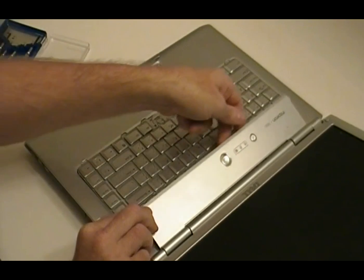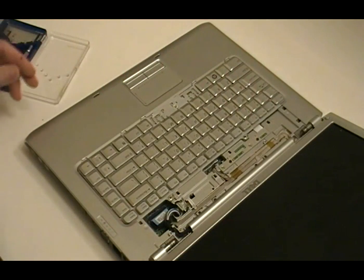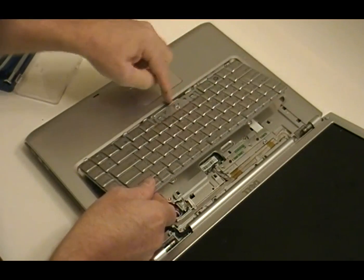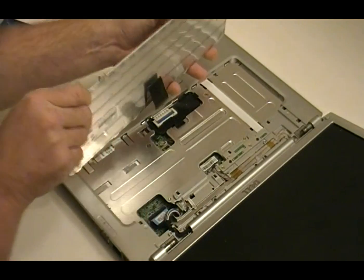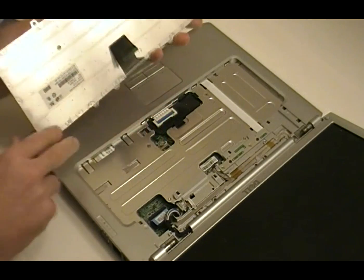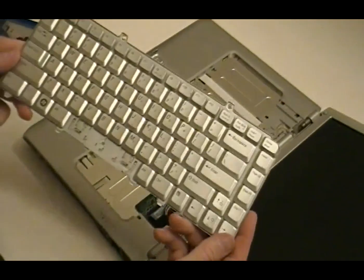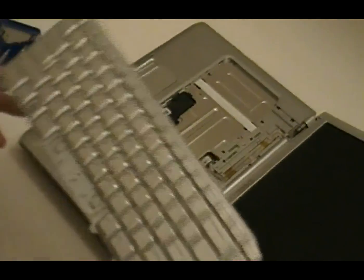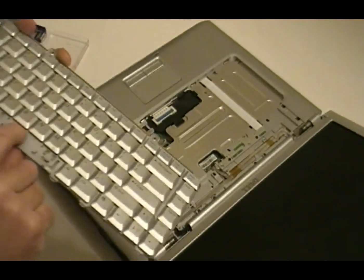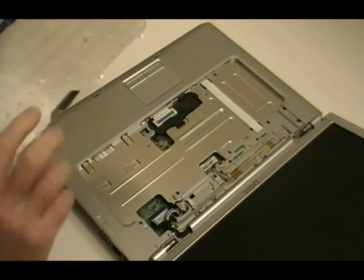Then you just work your way across. Pull up on this side and there are a couple of tabs that will pop out. When you flip it over, you'll see there's a little hook, and on this one there's just a single cable that goes in, which is pretty nice. Here's why I went ahead and replaced this one — you could just fix the key if you wanted, but sometimes the underneath of the actual touch part gets worn out, so to me it's not really worth it. It's better to just go ahead and do it right.